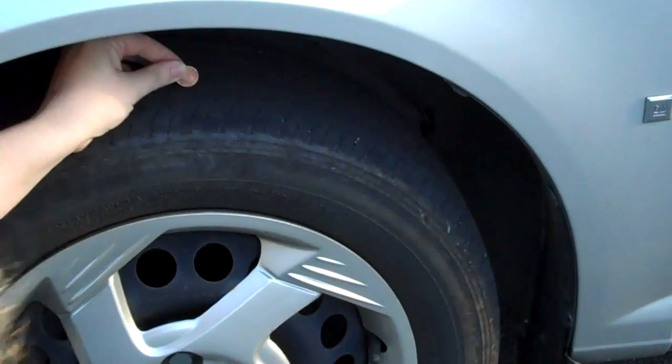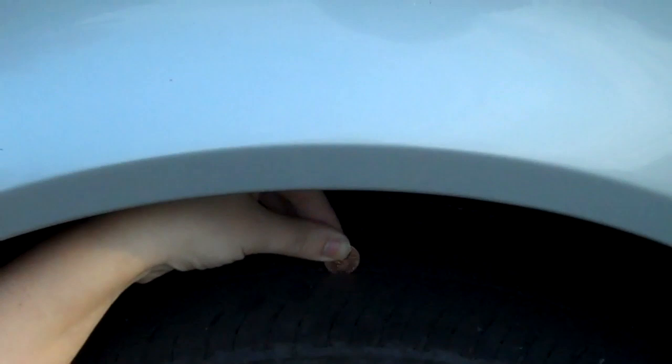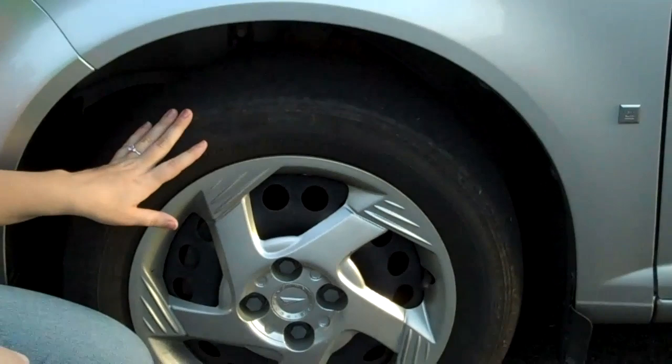If we go over to this car over here and you put it in, you can most definitely see the top of Abe's head. So honest Abe has told you it is time to change your tires. As you can see here, it's balding on the outside of the tire. What that means is that, generally, your tires are under-inflated.